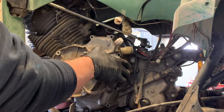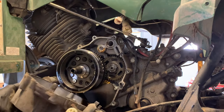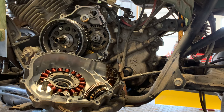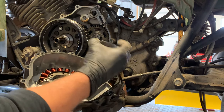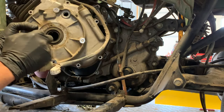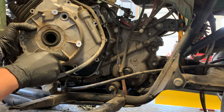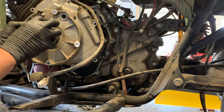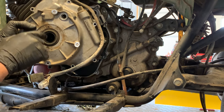Now we are completely detached from the four-wheeler. We can pull this off. The correct answer is yes — there is going to be oil in this charging system. That is not true for all of them. There are other brands, like some Polaris models, where there should not be oil in your charging system. That seal I showed you — because there is oil in this housing, this seal is a fairly common problem. If you are seeing oil dripping out of this bottom notch, take your recoil pull starter off and inspect this seal — that is more than likely where your issue is.